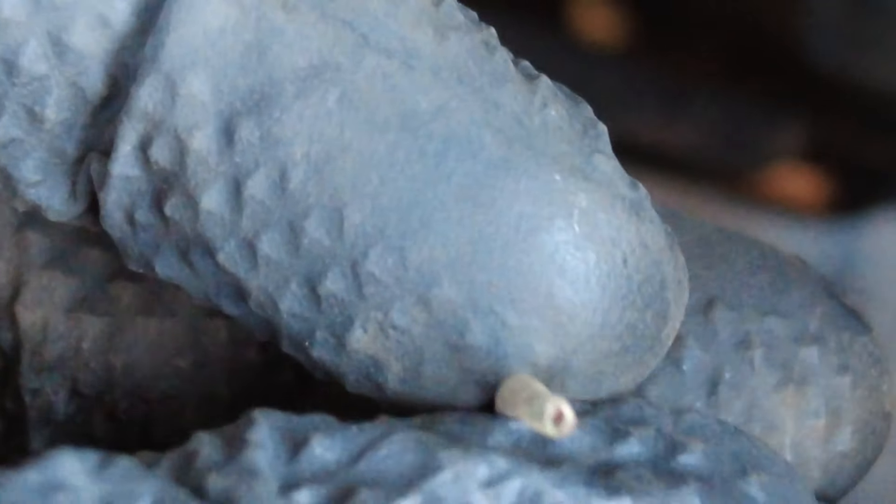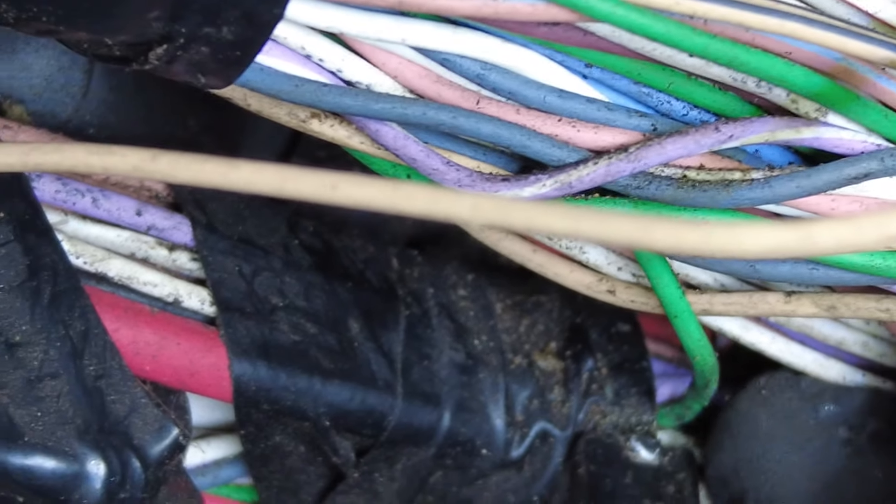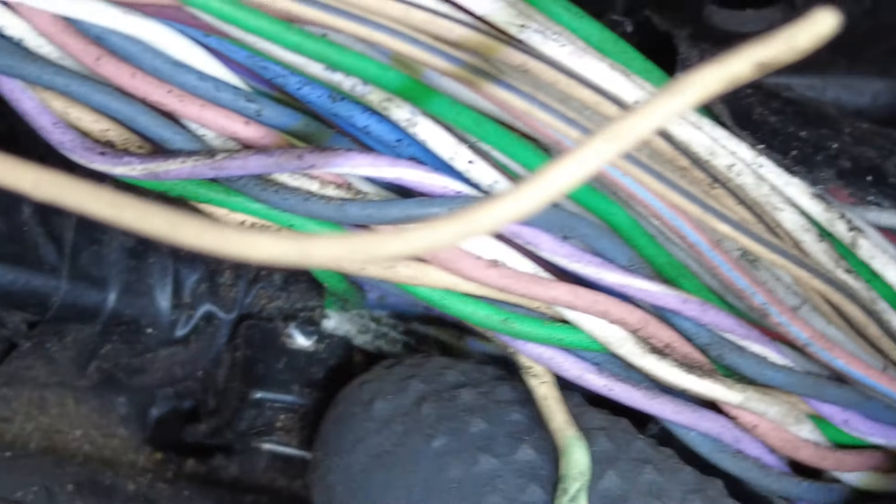There we are — there is a wire there. I've given it a tug and it came apart. There's a bit of corrosion on there, hard to pick up with the camera. We need to find the opposite end — that's coming from the engine ECU. There's the other end and it is nice and green. It lives underneath a cable tie which is very tight, so we cut that cable tie. You can see the green wire clearly now.